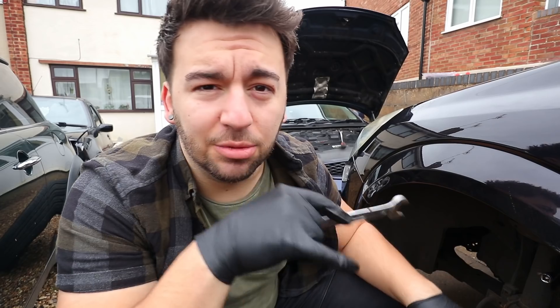I hope I explained that alright — I just wanted to share that in case you come across either one of these. I've never come across a different setup, although I haven't worked on every single car in the world, so there may be other ways. But these are the two most common ways: you'll either have flats on the back or you'll have an allen key or sometimes a torx key in the actual shaft of the bolt itself. I think that's enough waffling — I'm going to crack on and get these things undone.